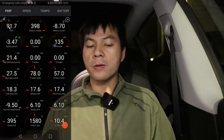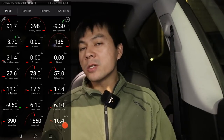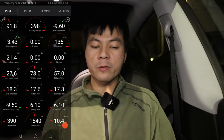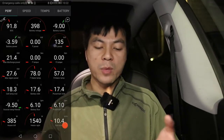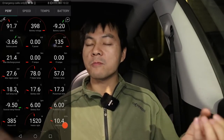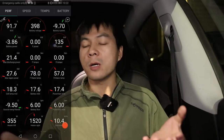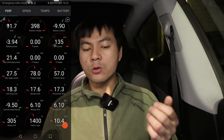The temperature was actually a bit higher before it cooled slightly, but 18 degrees was the right call because I wanted a high state of charge. During the trip from Rovaniemi toward Tromsø, it was minus 10 outside and the battery maintained 18 degrees — it got leftover heat from the motors constantly. Consumption was around 230 watt per kilometer even driving fast, and I left with about 92% charge. Very interesting to see how Tesla Model 3 prioritizes things.